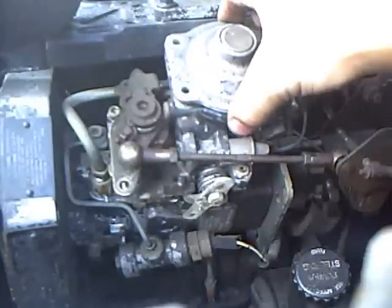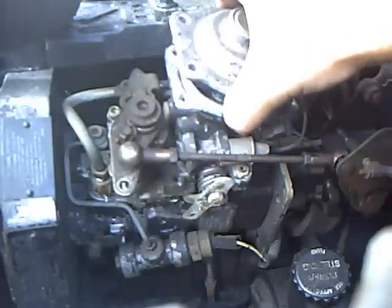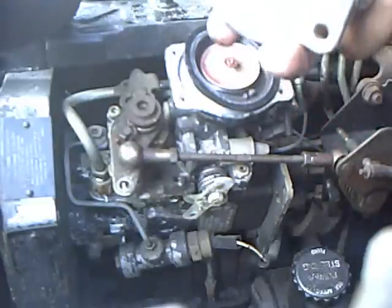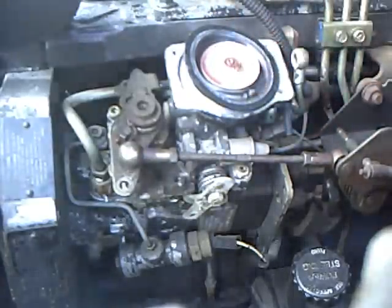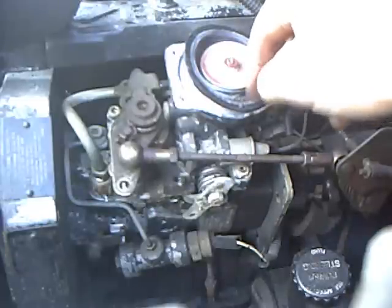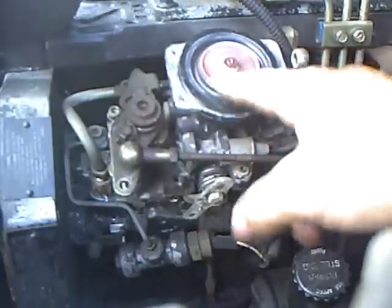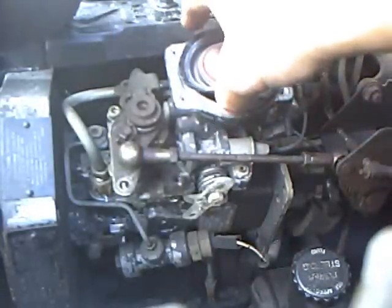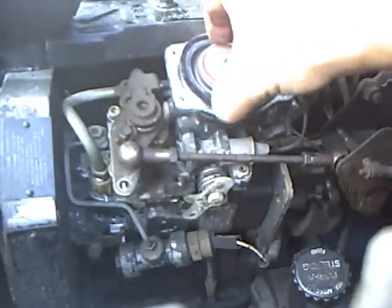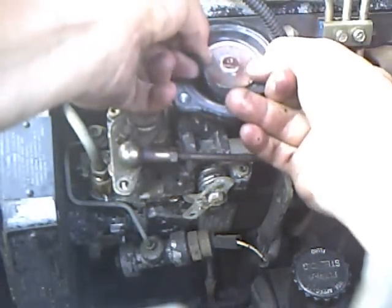So, pull the cap off really slowly, and this piece right here might come out with your cap, depending. So put the cap aside, and if you've got some junk in there, make sure you get it out. I haven't seen one yet that doesn't have junk in there. It's just dirt out of the turbo. Yours might be like mine and need a little force to come out.